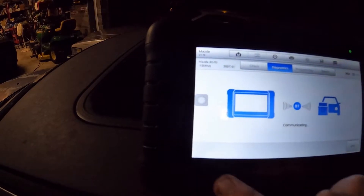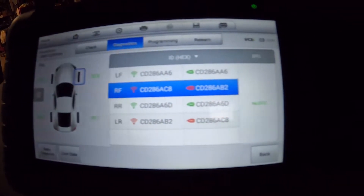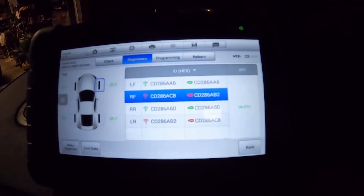If I go to diagnostics and retry, there are no DTCs — no diagnostic trouble codes — which tells me it's a problem with those two sensors. I'm not too incredibly worried about it because before too long I'm taking this in for four new tires, and the sensors are about $55 to $60 each depending on which one you get — we're getting all four brand new. Plus, this is an '09 so it doesn't tell you exact pressures on the dash — it just shows a warning light when a tire goes low. Since the sensors are getting replaced in a week or two anyway, I'm not going to press this issue.